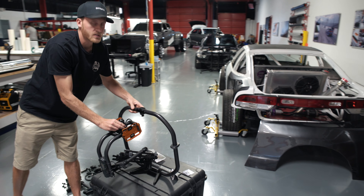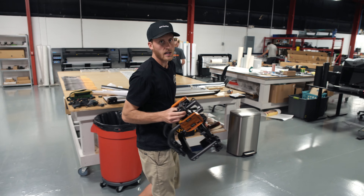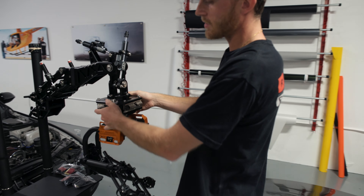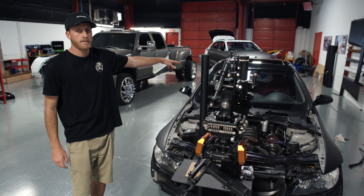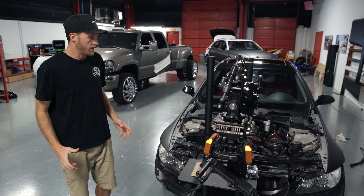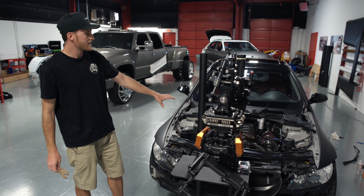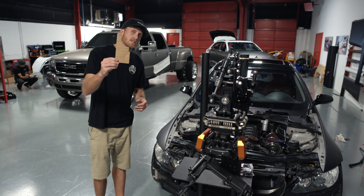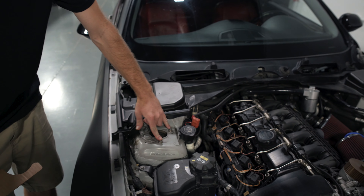This quickly removes from the ground cam and we can put it directly onto the car. This is a full stabilizing arm, so it works in tandem with the gimbal and gives us a lot of freedom. If you've seen camera car stuff before, you always see suction cups and large tubing — I don't want to do that. I want a full chassis mount setup, basically replicating a strut bar, so I've been making these templates to use two of the factory strut bolts.